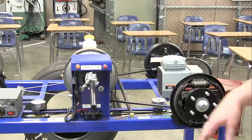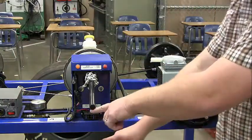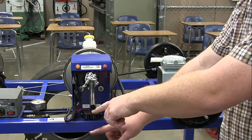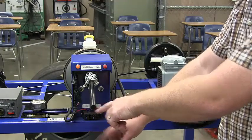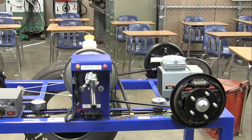The other thing you want to do is check the pedal height. We want to measure from the bottom of the pedal to the floor and see what that pedal height is, making sure it's at the right spot. You're going to have to look that up on Identifix to see what the spec is.